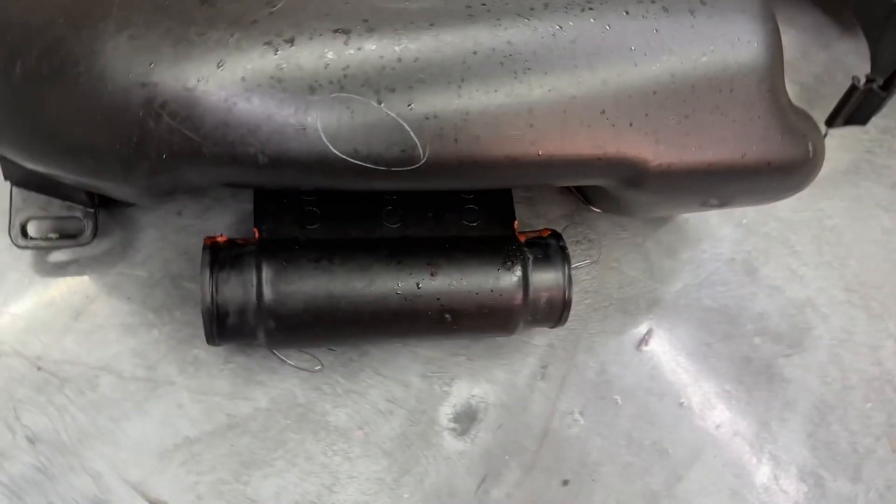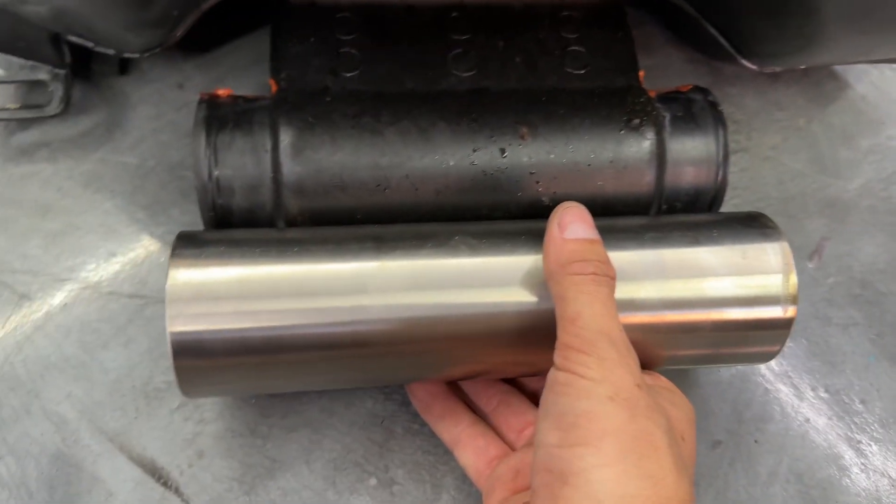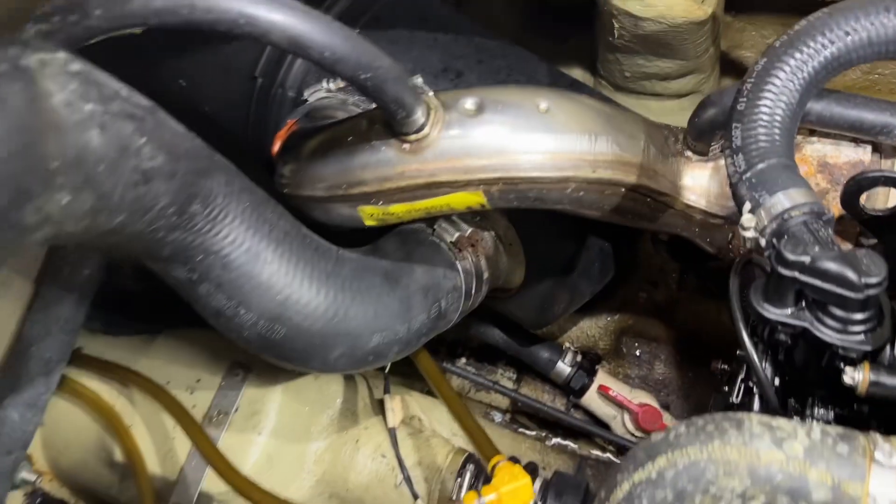I've got my little piece cut. If I'd taken notice of the original resonator I could have just measured that section — it's literally just a straight pipe. I've gone a little bit bigger, which isn't going to matter. It sits on a silicone coupler on both sides, so it should be pretty sweet. Alright, done — simple as that, a lot easier than I thought. I've got my hose clamps back on. I will be replacing these hose clamps because I'm not a fan of how rusty they look. I'll leave a link below to the eBay listing, or you can just go to your local exhaust shop.